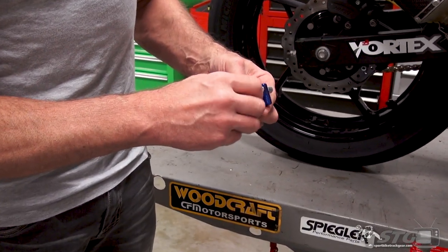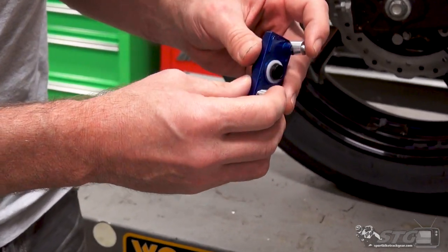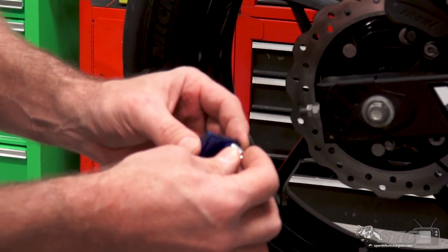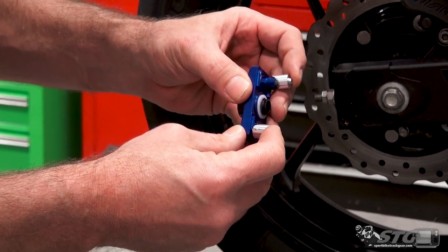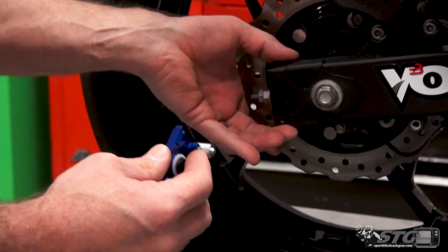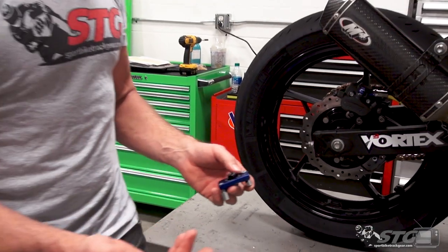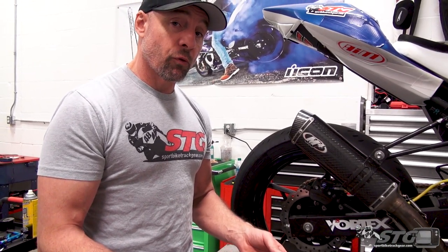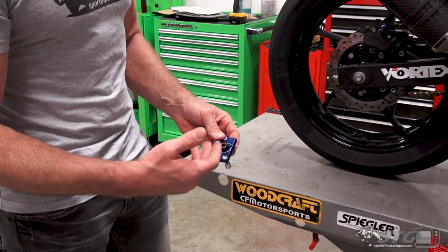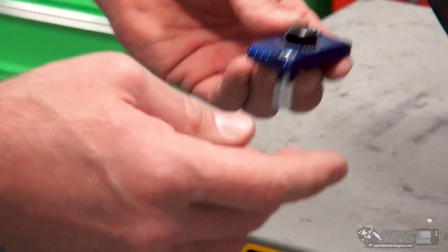How Driven's done this is by having this nut captured, and then having these two cams on either end. They oppose each other. Essentially, this slides into the swingarm. You tighten these up, and as they travel down the ramp, it puts outward pressure and holds itself into place. It worked pretty good on the R3, and this honestly looks like we'll get an even better result on the Ninja 400. Available in multiple colors — you can see the cool machining. Driven's kind of famous for that. It's all made here in the U.S. Beautiful colors, beautiful machine work — it's like artwork for your motorcycle.